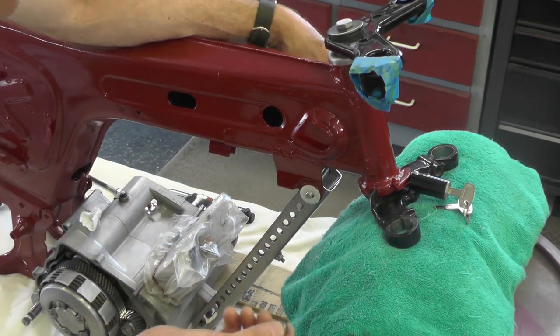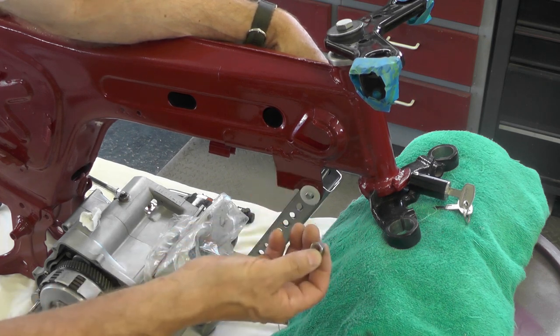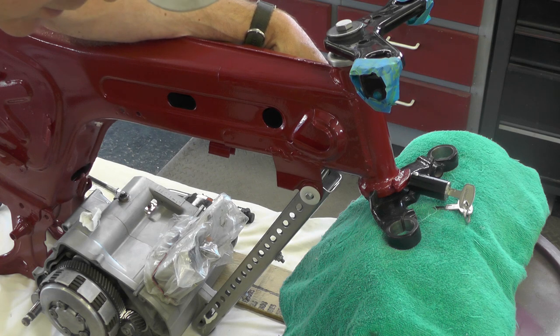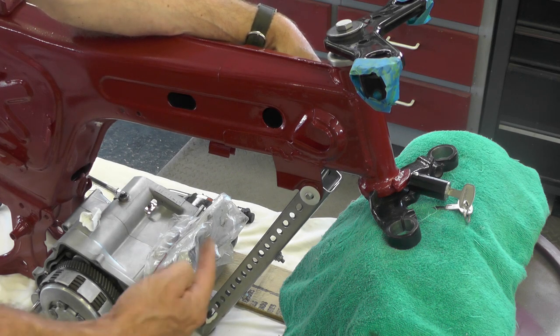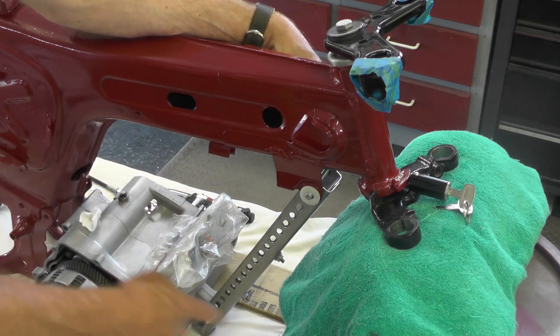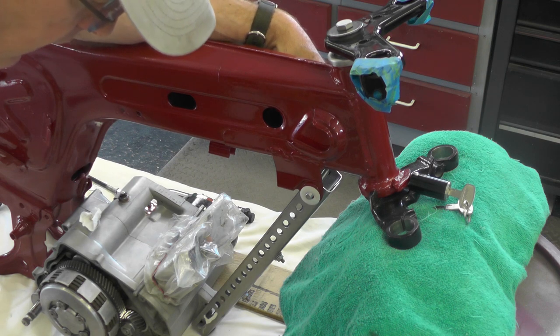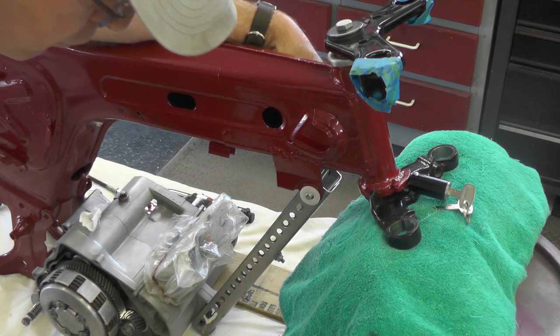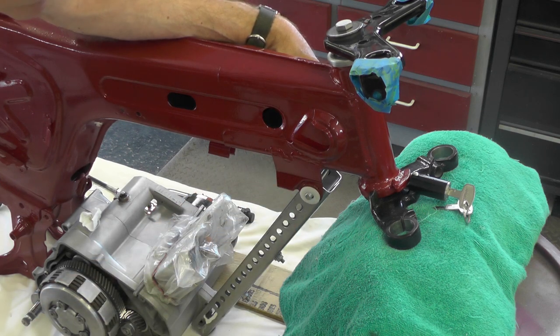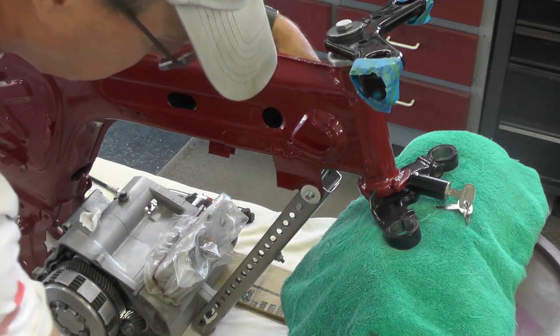I dropped the nut as you saw, and that gives me a reason to pause here for a moment to talk about a couple of things that just occurred to me. You'll notice this old sheet that I have down, and underneath that is a towel. I've shared this before, but when my wife circulates linens out, bath towels, wash towels, sheets and that kind of thing, she gives them to me and I use them in my shop. The reason I like either a towel or a sheet or both with plenty of padding is so that when parts fall, they don't drop and bounce and roll off somewhere, and I spend the next 20 minutes crawling around on my hands and knees looking for them. They tend to drop and stay.